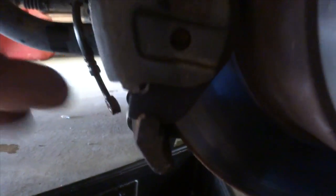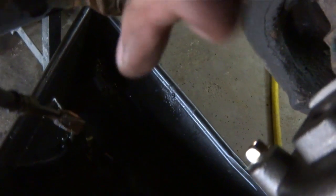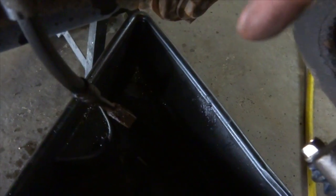Most people will figure this out, but your brake pads actually fit in a groove here, so when you put the caliper back on, drop the bottom end first in those grooves, and then tilt the caliper forward and it'll snap into place. Then reattach your two bolts at the rear, down there and right there, and then we're going to attach the brake line with one copper washer on the end, and then the brake line to another copper washer on each side.